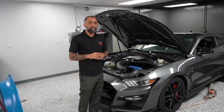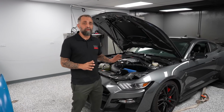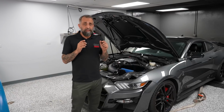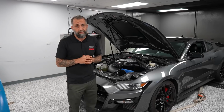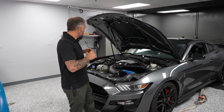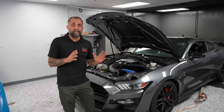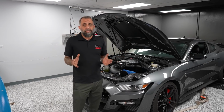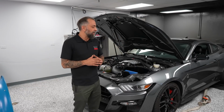We ran into a couple little issues, tuning challenges with the new setup, and I want to go over that. I wanted to give you guys a quick update on this car before we end the video. I was hoping to get it 100% done. We're not quite done with it, and I'll tell you why. This car is set up to be our X900S package, which means 900 crank horsepower on 93 octane fuel. So we started with the ported blower and the pulley, and I was having some issues getting the power in the ballpark. 900 crank should be about 800 wheel, and we were having some issues with high RPM power, and I wasn't sure if I was chasing the tune-up.